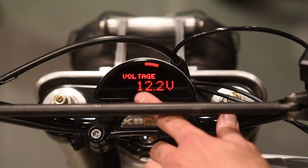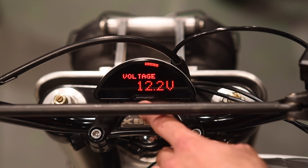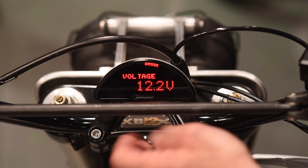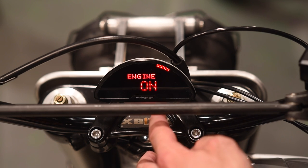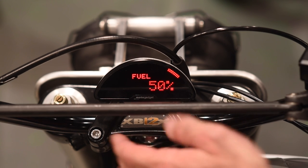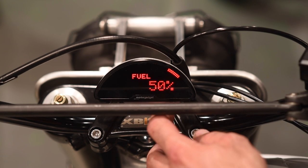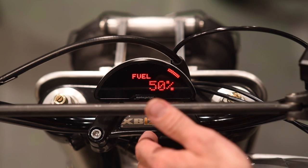Voltage alarm limit is set at 12.2 volts. If you're riding and voltage drops to 12.2 — or even anything below 13 — that's an indication of a charging system failure, and you want to know about that. This will display a low voltage warning in the screen two area of the gauge. Engine on — leave it on. Fuel 50%: this gives the delineation between a full and empty tank. Because we're using a binary low-fuel switch, it's set to 50% — below 50% gives a low-fuel warning; above 50% means you've got enough gas.